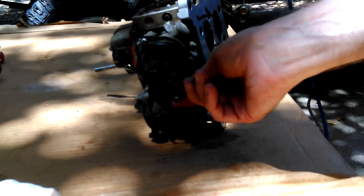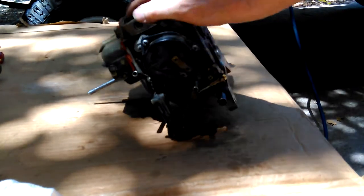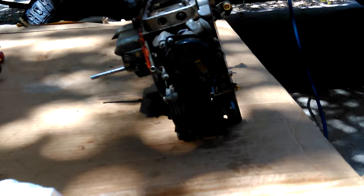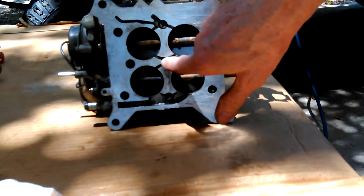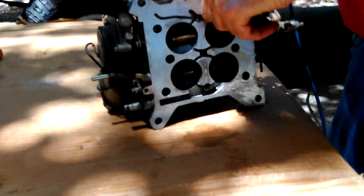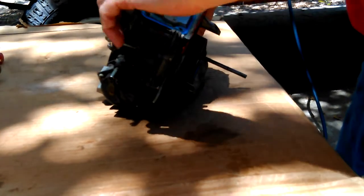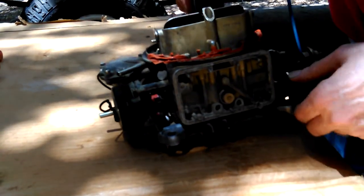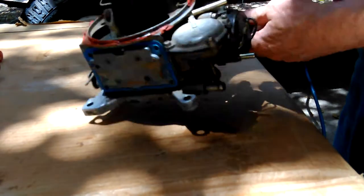And this vacuum line is part of the choke, right on the choke housing, so that's got something to do with it. Actually, I would have thought that was where it got its temperature. But I don't know. Unless it really is a jet and the choke actually controls that jet. I've never heard of anything like that, but not that I would necessarily know either. So, everything I can find, every orifice, every hole is blown out, and it seems to be passing air through it. So I'm gonna order a kit because I can put it back together and it might work. And then it could just be more horrible trouble, or more trouble really soon.